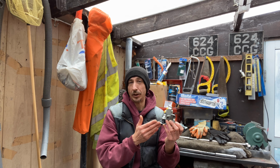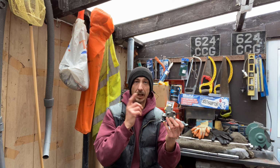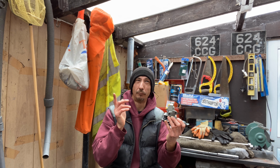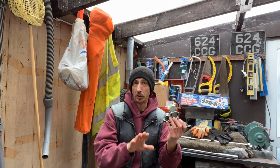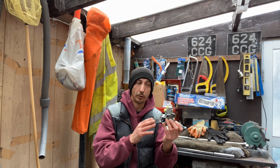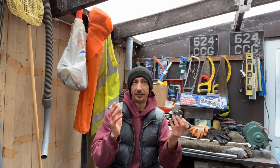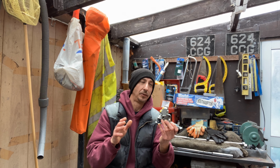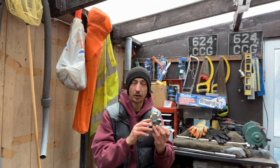The way of actually doing it correctly, you need pressure gauges on the front caliper and on a rear caliper on the opposite corners. I believe it is the front right and the rear left. And then that way, when you apply the pressure on the brake, once it's all bled through, it should give you the readings. And Volkswagen have those readings. There's nothing in the Haynes manual. I can't really find a lot online about it. It's been quite a struggle.